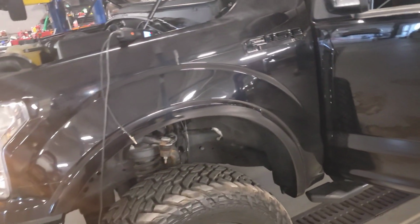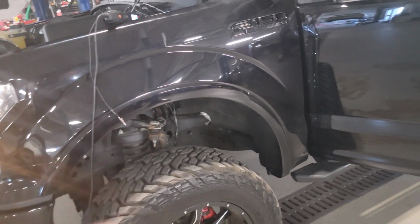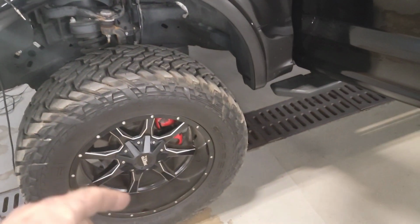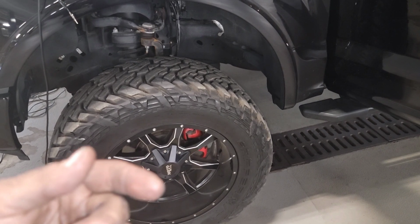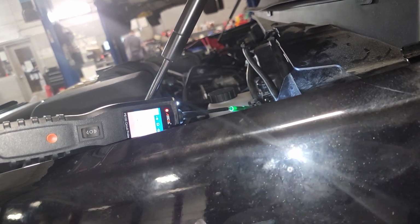Every time you turn the key off and turn it back on, no matter what mode you're in, you will be in four-wheel drive for the first half mile of that run, and then it will disengage the four-wheel drive and give you two-wheel drive once sufficient vacuum has been reached. That's a new operating strategy to protect the IWEs and make sure there's sufficient vacuum so you don't have them chattering and chewing up the back of the wheel bearing teeth and the IWE teeth, the engagement ring. So that's how the system works.